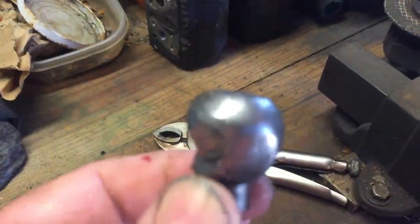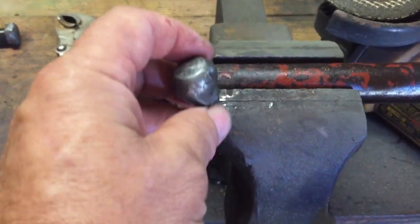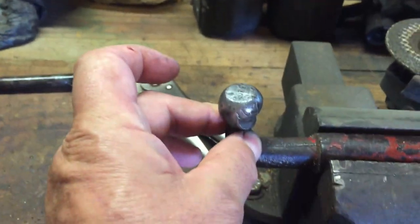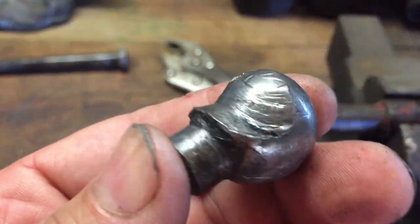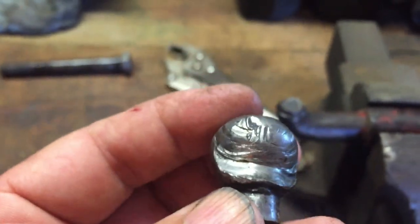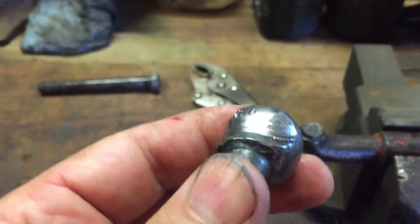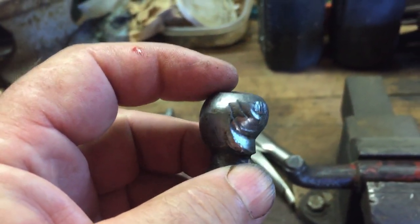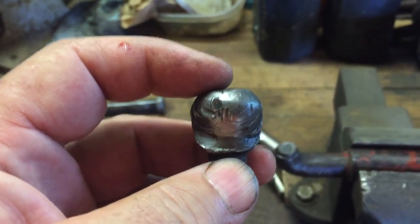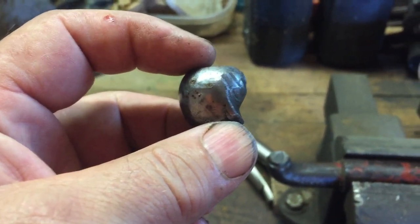We broke the little ball off the end of the left-hand shaft — the one that goes up in there where we put the new parts. I'm considering what caused that. This ball is very rough and worn; I didn't think that would be a problem, but perhaps with the hole in the center of those seats it might have been in a bind. Also, I had just gone through a ditch up onto the driveway when it broke, so I don't know if that had something to do with it. It's kind of back to the drawing board — get the welder out and the grinder and go from here. Trial and error.